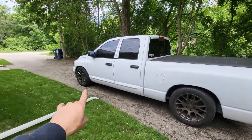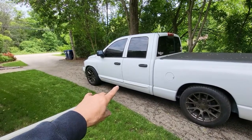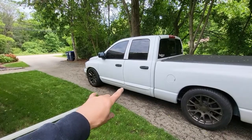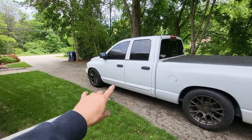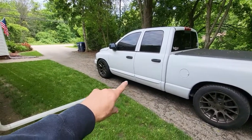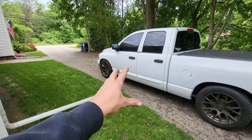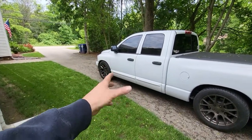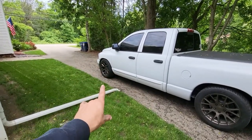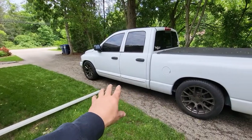On the bottom of the doors, the driver's door was pretty rough. I had to do a cutout and replacement right there. You can see there's a little ripple. I opted not to spend a bunch of time doing body work on that, but to just get the metal replaced, because it does actually probably need a door in time. That bottom weld isn't awesome, not long for this world much more. Granted, it's not going to see any winters anymore, so it could last for another 5 or 6 years, or it could look like crap in 2 months. Who knows? But from the body line down between the wheels is all new, redone.